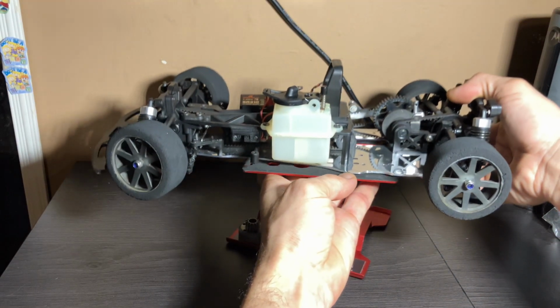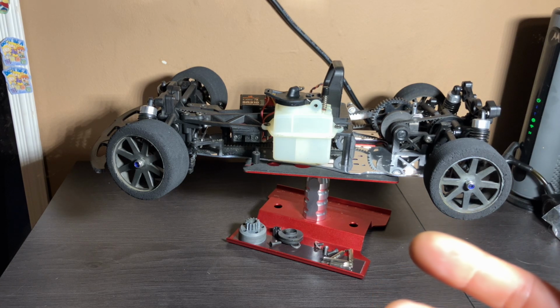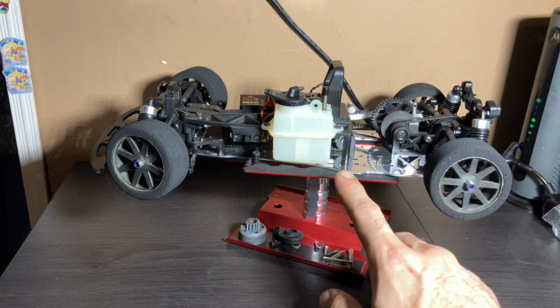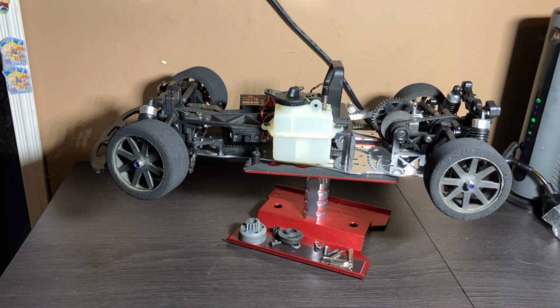And after all that checks out, you can basically put your vehicle together, figure out where you're gonna route your fuel lines, route those. I like to route my fuel lines right before I drop my engine in, because sometimes it is hard to get to this nipple here. So I pop that in first and try to get a mock-up of where I want it. And then I would set everything up. So I'm gonna take the vehicle off the stand, and I might be doing one other thing, but we'll see when we come into the next clip. Give me 1 second.